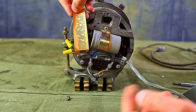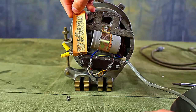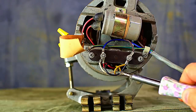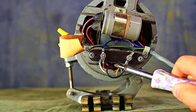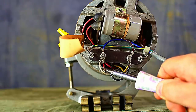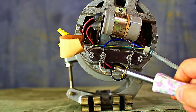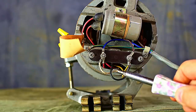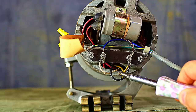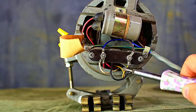So if you have a lamp that uses 6 volt bulbs, you can wire it in here. Now down here you can see two posts. On this post there is a black and a yellow wire, and on this post there is a white and red wire. This determines which direction the motor will spin, and if you look on the tag, you can change the direction of the motor spin by changing how these are wired together.